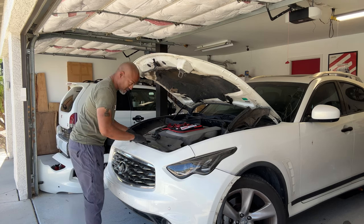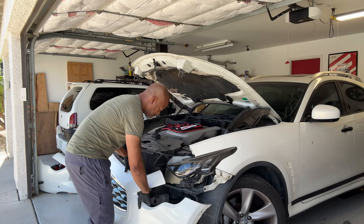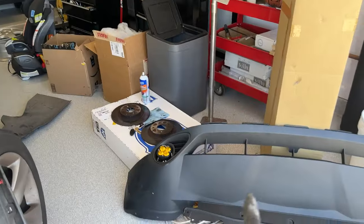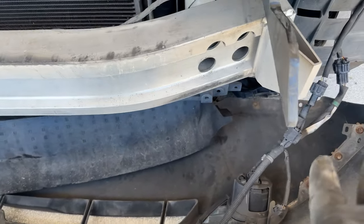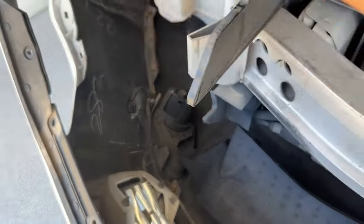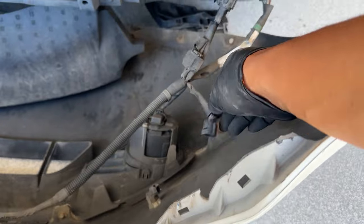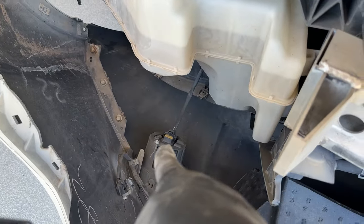There's one retention clip up here — I believe that should be it. I'm going to get the wires — main wiring harness. I want you guys to take a look at this. The bottom part of the bumper is attached with all these 10 millis also, so keep that in mind. I'm taking the whole unit off at once because I have to change it out. There seems to be about 12 of those. I started disconnecting the sensors, but really I just need to disconnect the mains here — these two — and obviously the fog lights. I'm sure we're good to go.